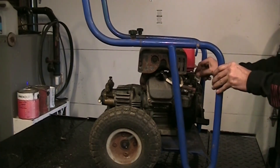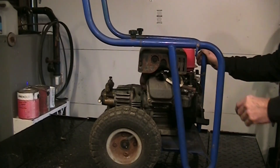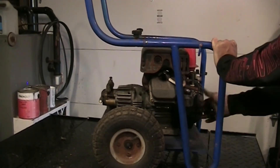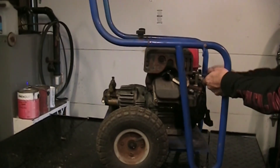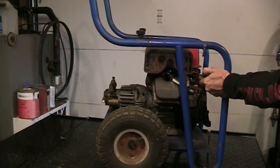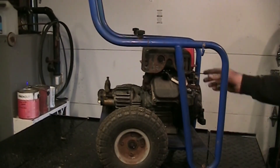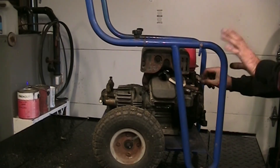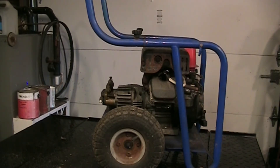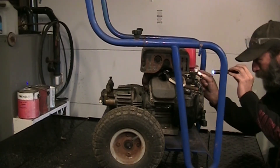I'm not seeing anything overflowing. We'll set the throttle about halfway - choke fully on. Here we go, give her a pull. The throttle does nothing. I don't want to run it too long - going from slow to fast does nothing. I think we've got something seized up in there. I'll take that apart. It's all rotten to hell in there. She's rotten.